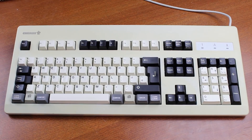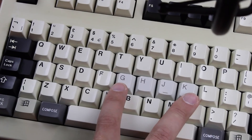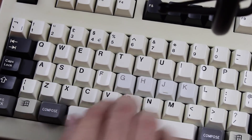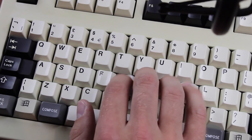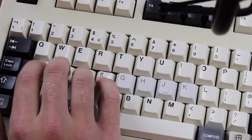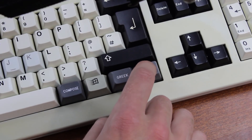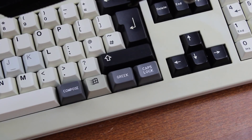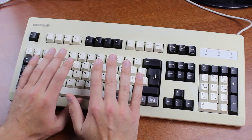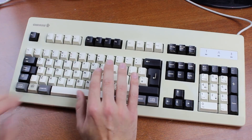Taking into account the acoustics, you can upgrade the sound considerably by using different keycaps — that's partially why I decked out this keyboard in a slightly fancier coat than usual. For example, compare the sound of the switch with Cherry's standard thin laser-etched PBT caps, with that of their older thick ABS double-shots. Stick on thick, tall ABS spherical double-shots and the plot thickens yet further. That's a pretty sweet noise actually. So in a good chassis and with nice caps, I'd say these are better than MX Blue. They feel a little bit nicer and crisper for sure, but most of all the sound is just a lot better, and honestly that alone is enough for me to switch.